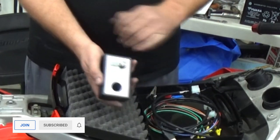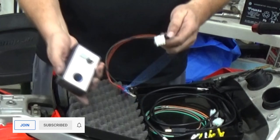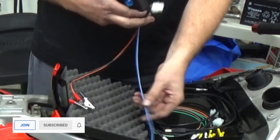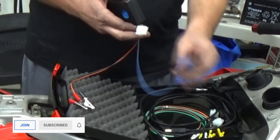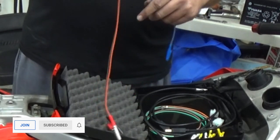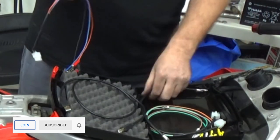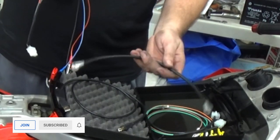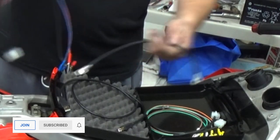For the relative compression test, we go right to the battery. On vehicles that allow it — this one wouldn't — you can go to a coil or throttle body, more for modern vehicles, and you can tell which cylinder is which based on hookup. The kit also includes a two-lead cable for checking sensors and individual coils, and a three-lead cable for testing your charging system. We'll do videos on those in the future, but for now let's focus on the relative compression test.